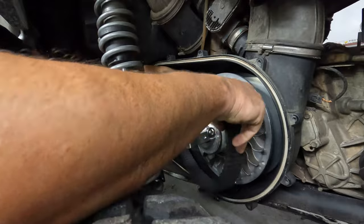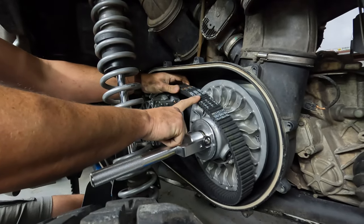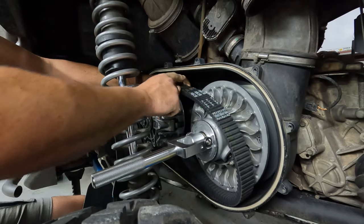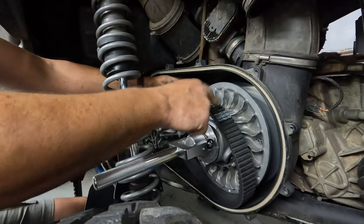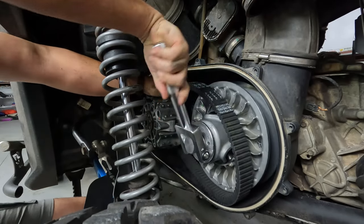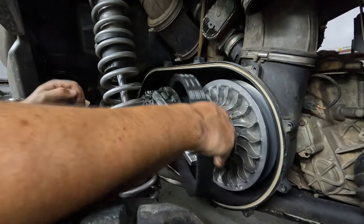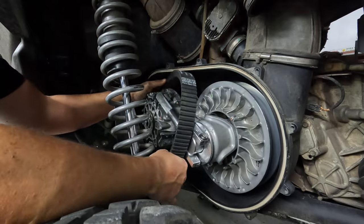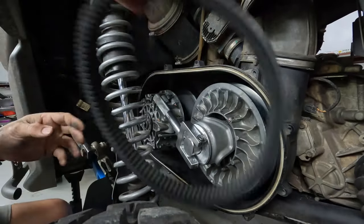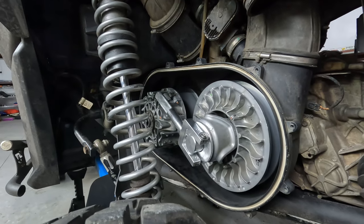And it's also important to look at the orientation of the belt. So this belt is a world's best belt. And I can see the writing is facing me, so I know that it's got to go back on the same way. So now, this doesn't matter. You can either pull it off or out of the way, because the belt's going to have to go around it. And then you're going to have just enough space for it to just pop off like that. It never happens like that normally. We'll gently set this aside for reuse later.